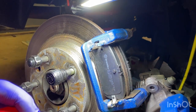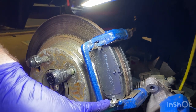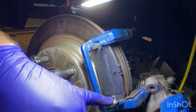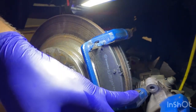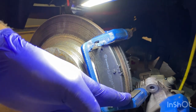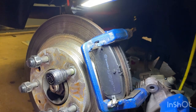I'll put the link in the description below - I think they're about 32 quid for the set, both sides, with the shims in. The wear indicator goes this side, which is the driver's side in the UK. Just follow the old one really. The shims - or metal bracket holder things, clamp springs, guard plates, depending where you are in the world they're called different things - put the new ones in. Put them in before you put your copper grease on, and put a bit of copper grease on there - not a lot at all.